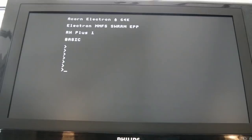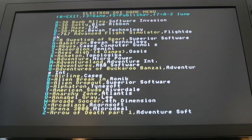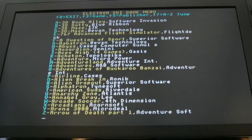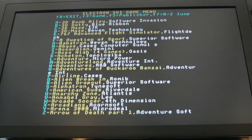Connecting the Elk SD64 expansion - the smaller connector on the left, larger on the right. Powering up we can now see MMFS file system, sideways RAM, and 64k rather than 32k. I need to get games onto an SD card. The SD card goes that way up - then hold Shift and press Break to load from it. This works the same way as the device I've used on the BBC Micro videos. There's one file on the card called B.MMB - a database or archive containing all disc images. You can use software to modify it and add your own disc images.